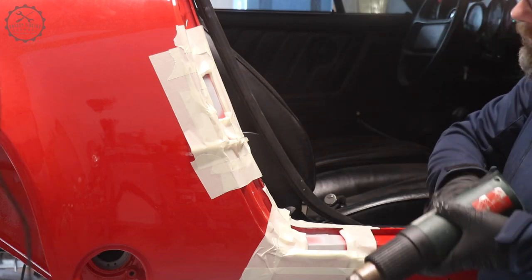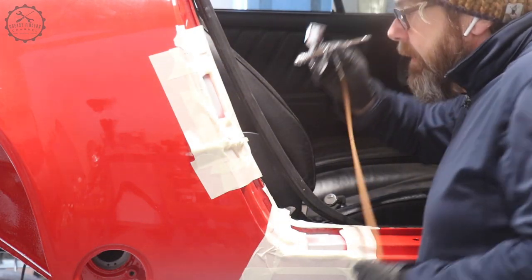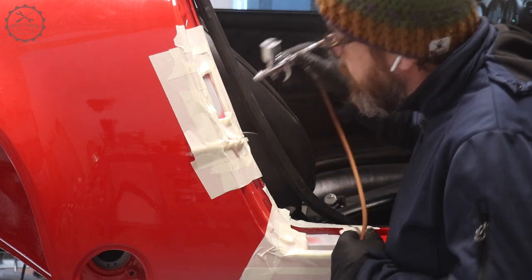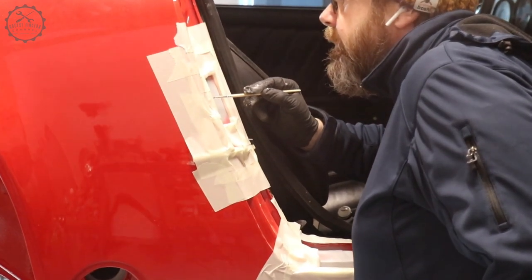The main part of the leveling work is assigned to the two-component filler. I'm applying a layer, drying it with the hot air gun, applying another layer, drying it. This is repeated 5 times at least, and specific irregularities are filled with the brush by dribbling a paint drop into the wet filler.